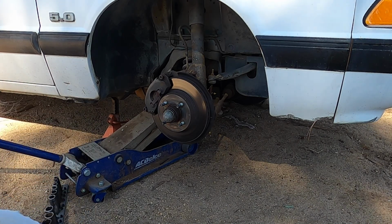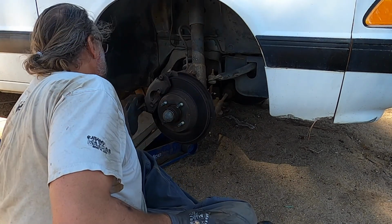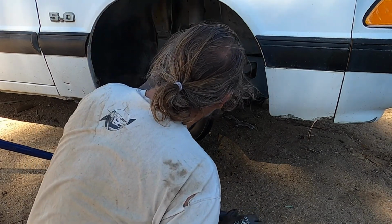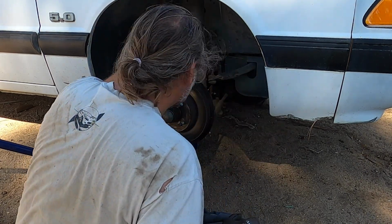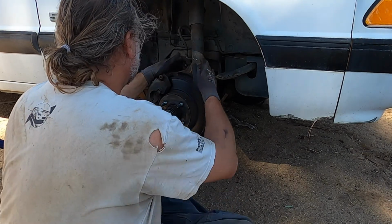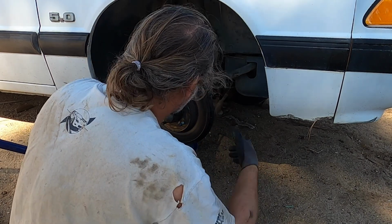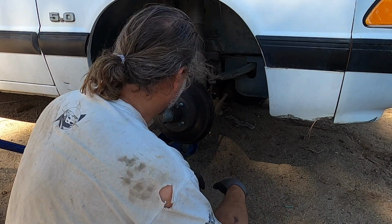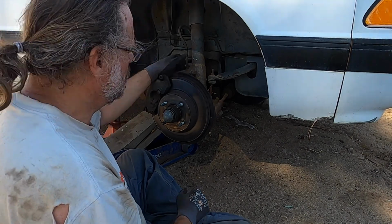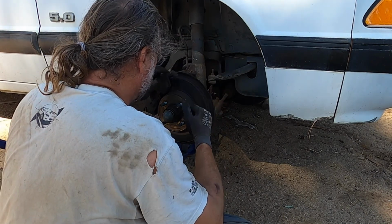Here, so this isn't gonna be that bad, because I think these two bolts here and then up here, and that comes out and the new one goes in. Now it is still a McPherson strut construction, so I have to get these two bolts out of the way. This is going to want to be a little bit floppy.